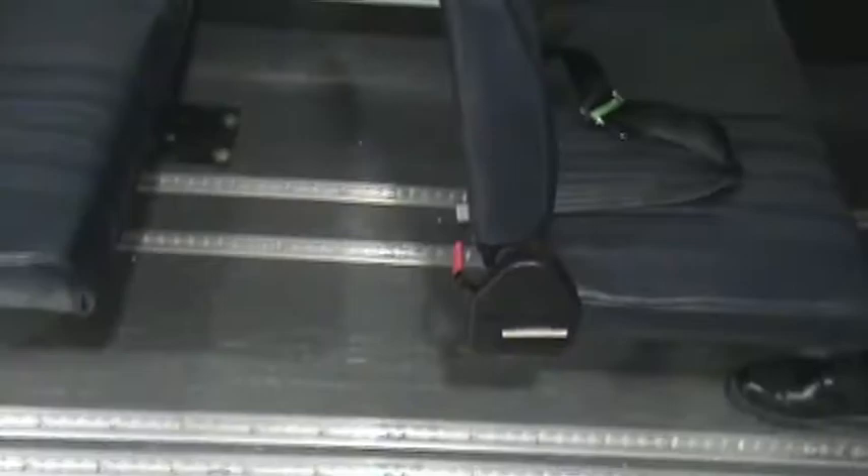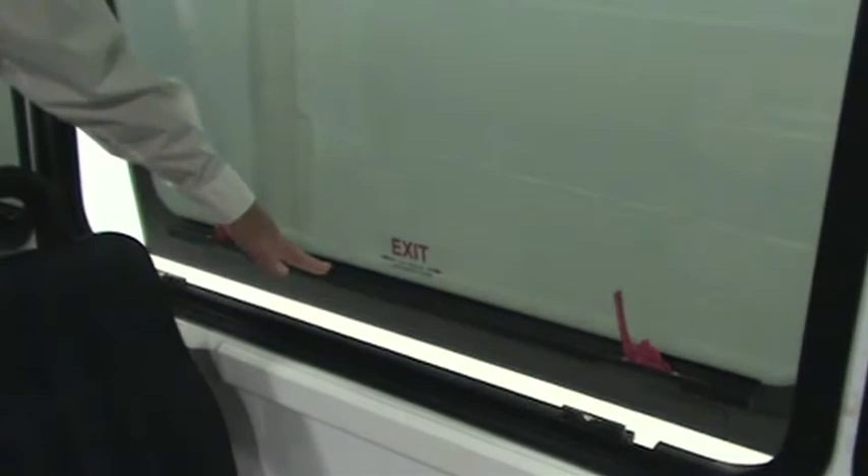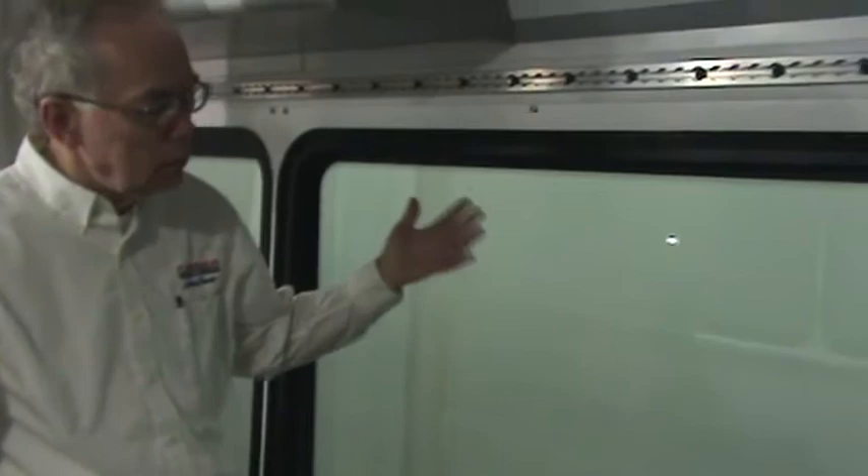Another item as we work our way to the back is a complete set of window blackouts or window covers. You're going to see the snaps on these lining up with corresponding snaps to cover the window. Also, all of the windows have exit labeling — pull handles, push window to open. There is a caution in the operator's manual: do not push the window out further than 50 degrees unless it's an emergency situation. If you continue to push that window out, it can detach from the top and drop to the ground, damaging the window. In an emergency that caution would not apply, but for testing purposes, don't push it out more than 50 degrees.